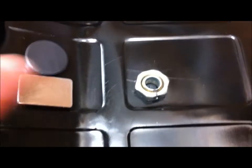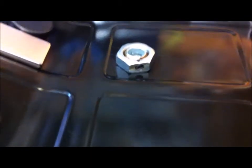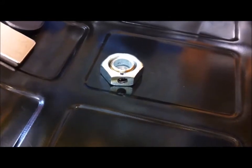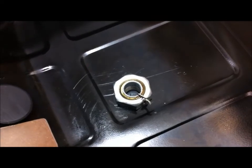I had another idea: I marked the position of the nut against the drain bolt, removed it, and drilled a 4-millimeter hole through both the nut and the drain bolt. I'm going to put a bit of lock wire through there so there's no chance it'll come undone, and it will also allow for better draining of the oil — the hole sits only about a millimeter or so above the base of the pan. I've reinstalled it with the non-hardening sealant and thread lock, and fitted a nice bit of stainless steel lock wire through there, so there's no way that's going to come out.